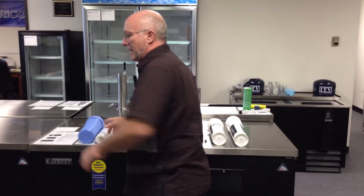Think about your shower. You take a shower three to four minutes every day, seven days a week. At the end of the week you've got hard mineral scale deposits all over your shower that you have to clean off every week. That's about 25 to 30 minutes worth of water hitting your shower every week. Your ice machine has water running through it 24/7, 365 days a year. You just extrapolate that out and you can see where calcium and scale and those hard mineral deposits really adhere to an ice machine and affect its performance. So that's the basic filter.